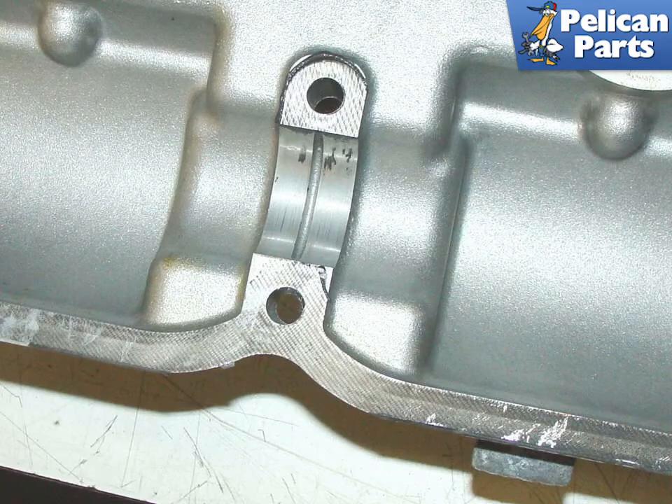This is one of the reasons I don't care for Porsche's recommendation of going 15,000 miles between oil changes. Shown here is an example of a camshaft bearing that is scratched and becoming worn. If this were on a 1965 to 1989 Porsche 911 engine, I would recommend replacing the bearing. However, the camshaft cover and cylinder heads are matched pieces — to replace this bearing, you basically need to replace the entire cylinder head, which is not worth the risk. Change your oil every 3,000 to 5,000 miles.